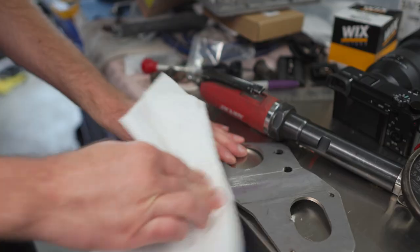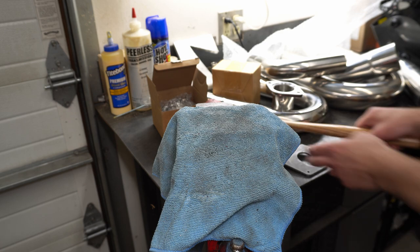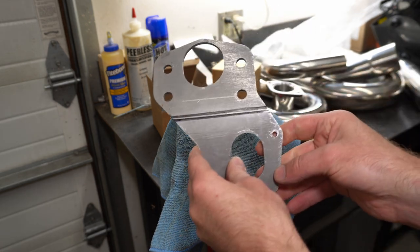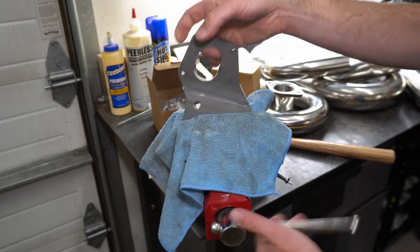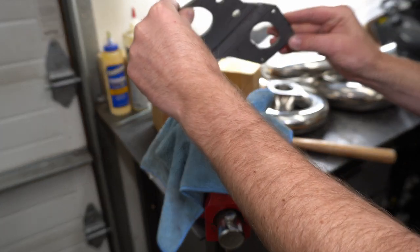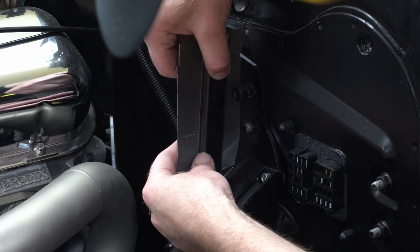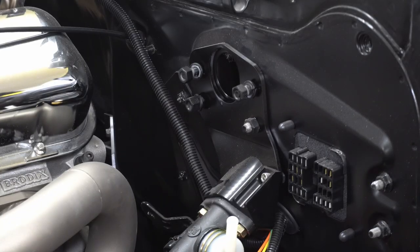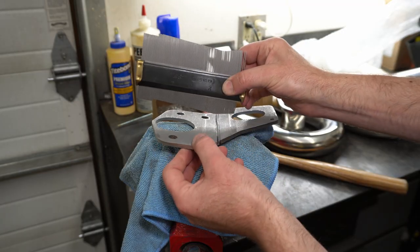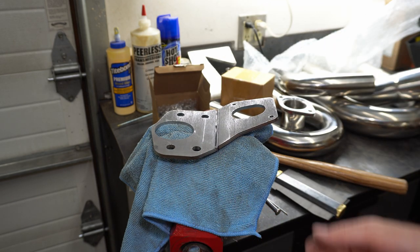We need to dispose of this wrong bracket properly - I think the next step is cutting this in half. I'm just going to flip it around and weld it up on the old TIG bench. I want this done today, not in another week. We've already been waiting three or four days for this bracket, and we bought the thing a month ago. I'll cut a couple of relief cuts, hammer it back, copy the correct angle from the firewall reference, and weld it up - right on the money.